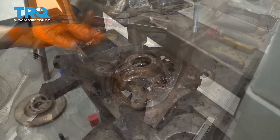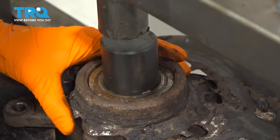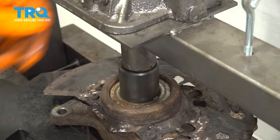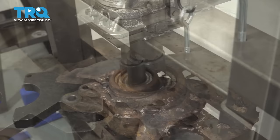What I did is with a hammer, I popped the inner race out from the other side and installed it on this side. What that's going to allow me to do is press the whole bearing out, because it has to come out through the side with the snap ring. Try to center this as much as possible on the press so nothing goes sideways. Now I'm going to press this down and the bearing should pop out the other side — it might make a loud noise.